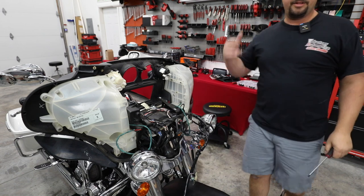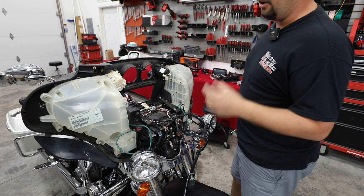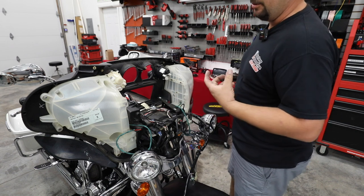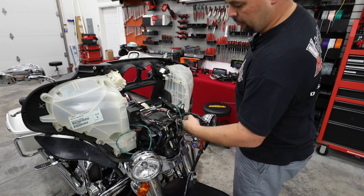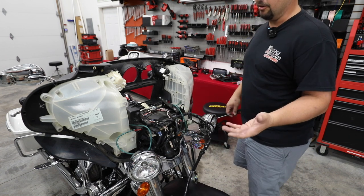Here is a tip. Most of you, I know, probably do not have an 11 millimeter on a wobble. And I'm not talking about an 11 millimeter socket and a wobble put together. I'm talking about one that is one piece, and that's what's required to get the three bolts on each side of the frame on these pods out. But there's an easier way.